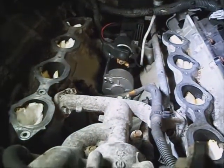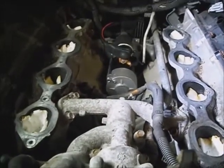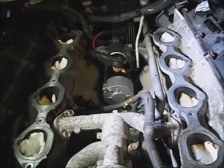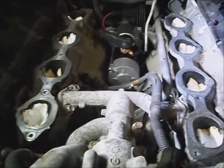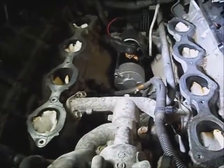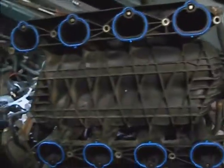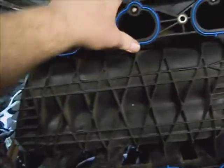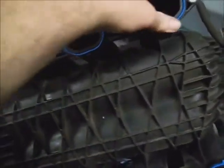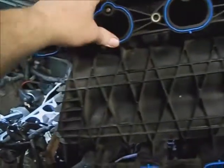And I've got the heads cleaned off around the intake ports. Pull the paper towels out and make sure there's no loose items down in the ports that shouldn't be there. Once all the seals are pressed back in, I've got little notches in those slots to hold them in there. Make sure they're all down flat.